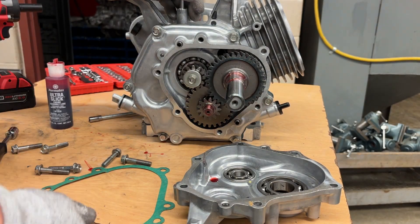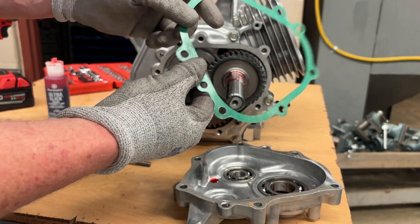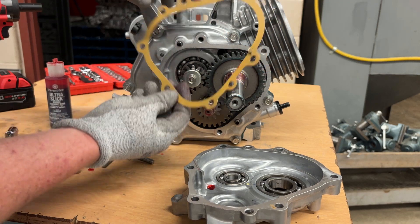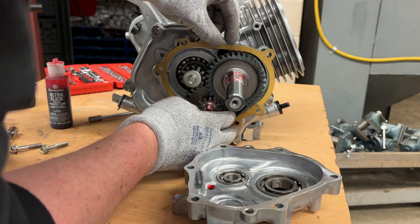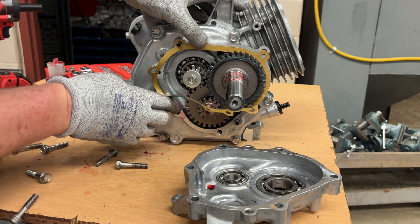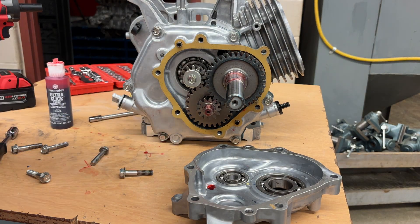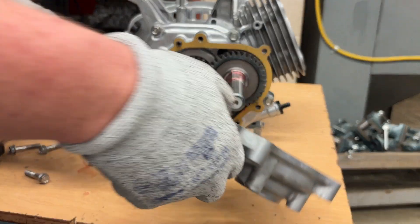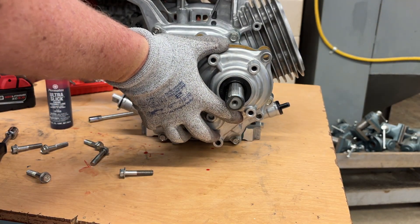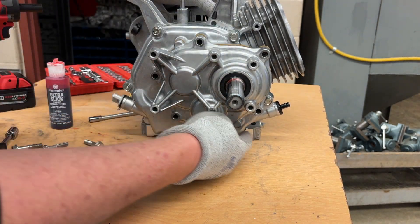This one here is a little bit tricky figuring out which way it goes. I always look for the three holes that are close together — those go to the bottom left — and the two that are close together go up to the top. Get that in place. A little tip: put a little assembly lube behind it, just a touch, and it makes it a bit sticky. Now this hole has to go on that journal — just wiggle it in place and it slides together. Check to make sure the gasket stayed in place and isn't sticking out anywhere.